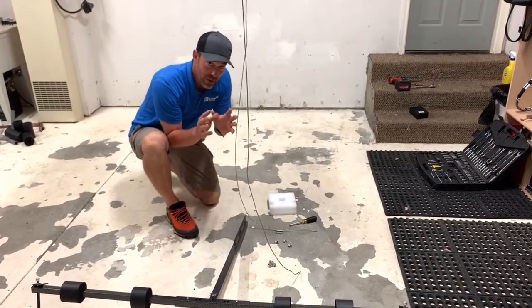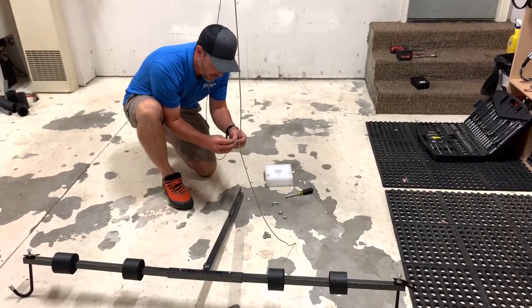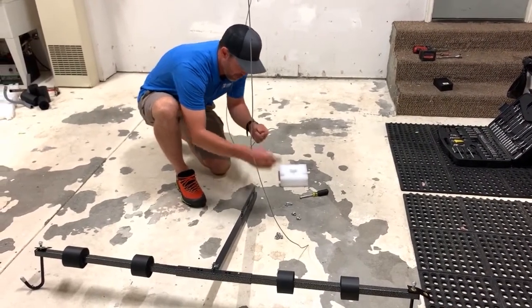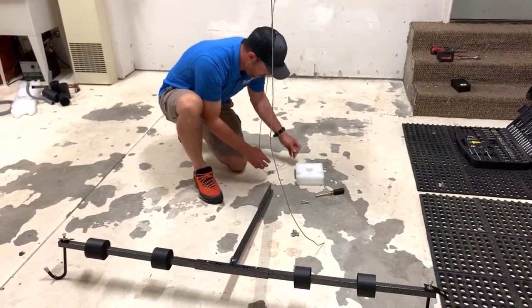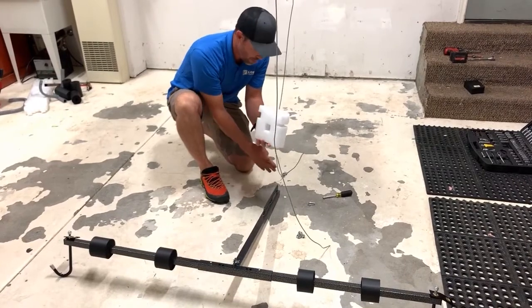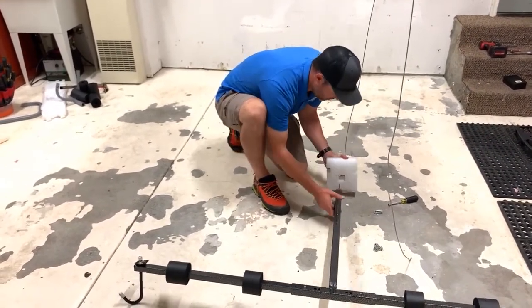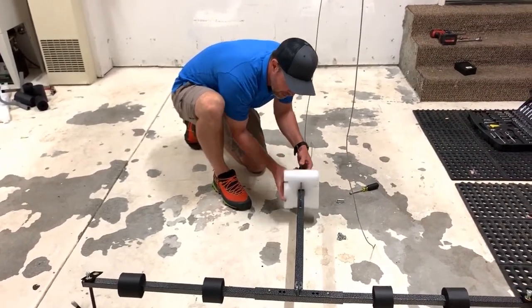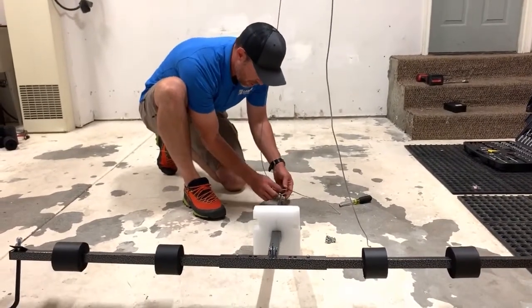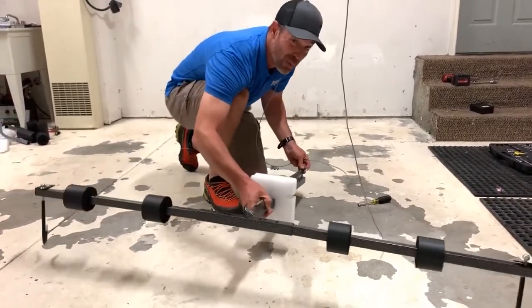Now we have to attach the wire to your lifting frame. It's a lot easier if you do a couple of tricks. First, loosen your wire nuts so they don't fall off, just loosen them up a little, and put those on first — I'll put all three on the back. Also remember that we have to put on a white piece of foam now before we put the cable on. The larger slot goes on the right side — thread that on, there's a notch where it goes right over the lifting blade — and push it out of the way for now.